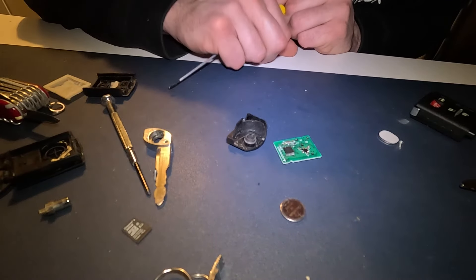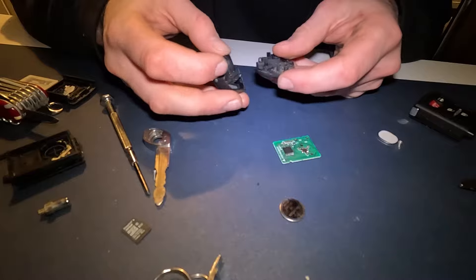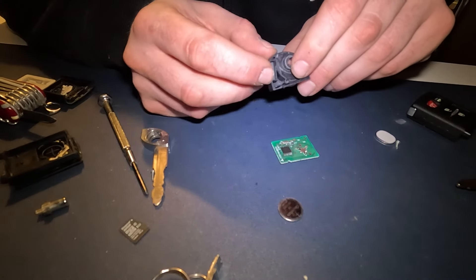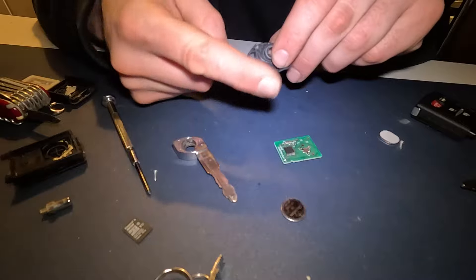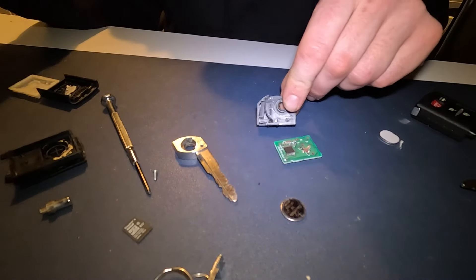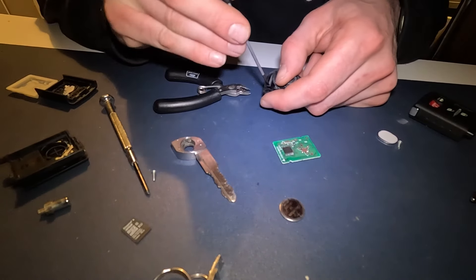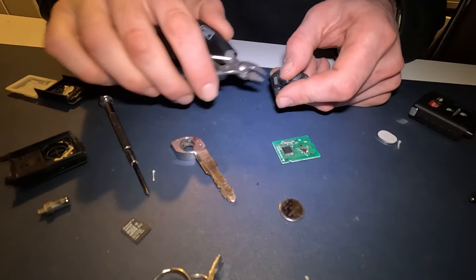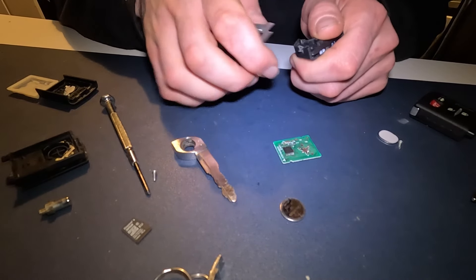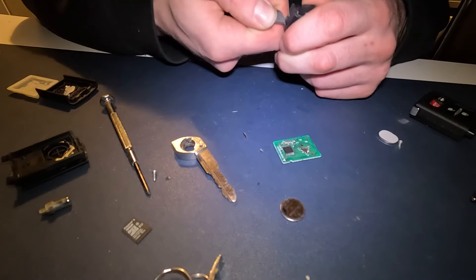I've made a mistake — bring back the bit that you chucked away. This is the housing bit, and in the top half just here is the little immobiliser chip. On the steering column where the key goes in, there's a ring around the barrel that picks up the chip for the immobiliser — don't chuck that in the bin. On the last one I tried to pick it out with a screwdriver and it just doesn't work. You don't want to break or fracture it because it'll stop working, so get some flush cuts or side cuts and just break away the plastic — that's the safest way, because this housing is going in the bin anyway.